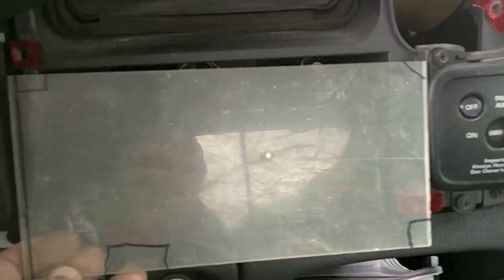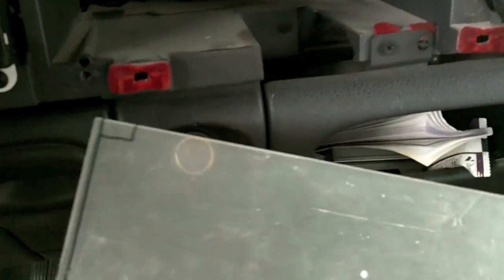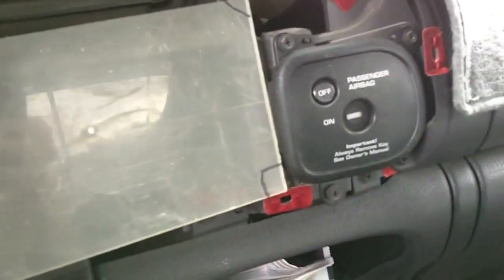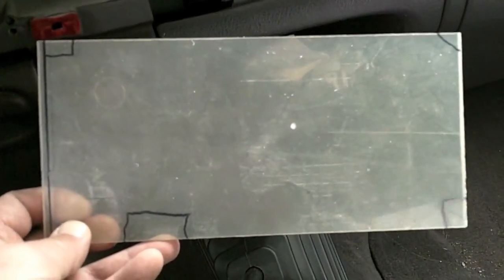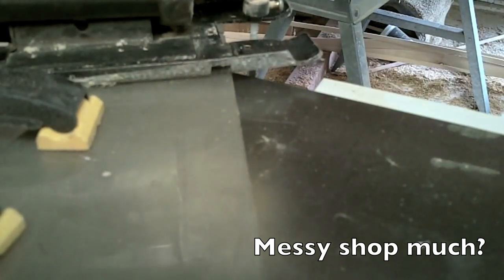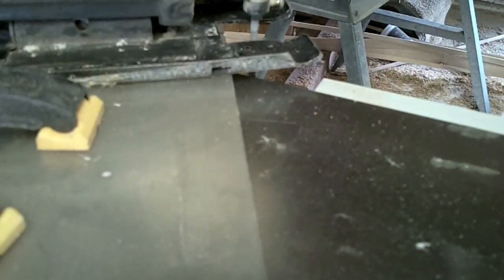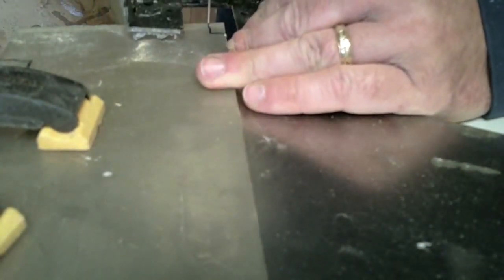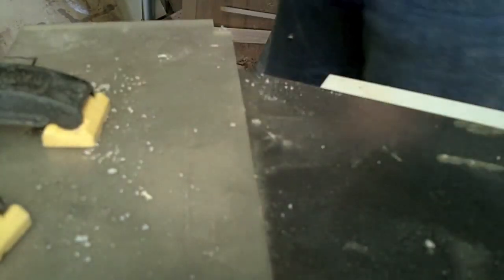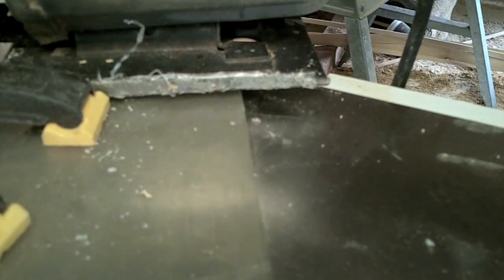Here it all is marked up. It's a little too long so I'm going to cut a quarter inch off one end. I've got it blocked out for the dash holes it needs to go through, and it should slip right underneath the passenger side airbag trim just fine. With the piece secured with a few clamps, I'll cut it with my jigsaw. When cutting plastic, it's best to run the saw a little slower — you don't want it to melt. Just like cutting wood, you don't want to languish in the cuts too long, otherwise it'll melt the plastic and leave a bad cut.